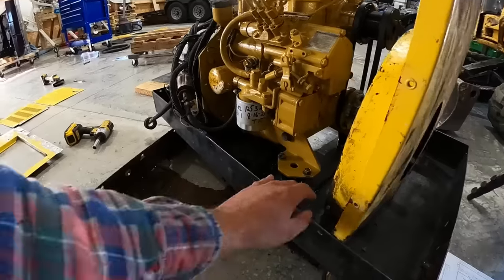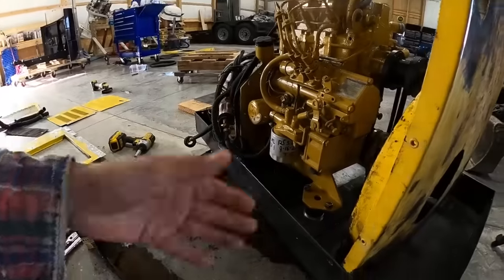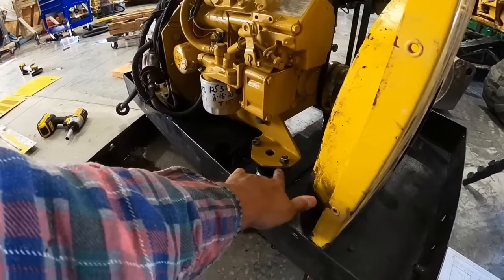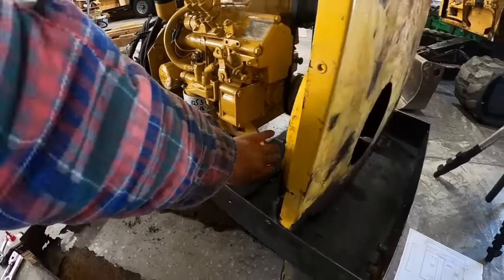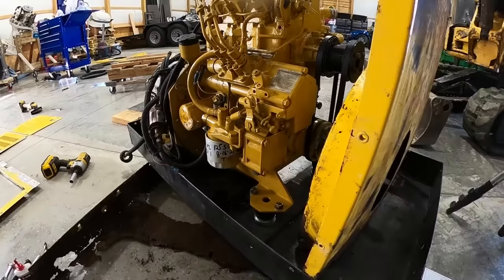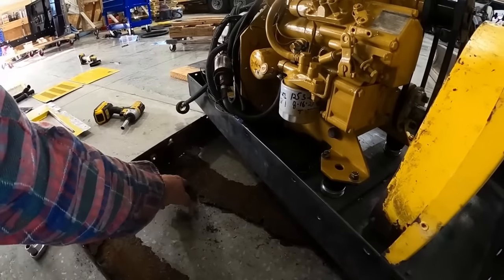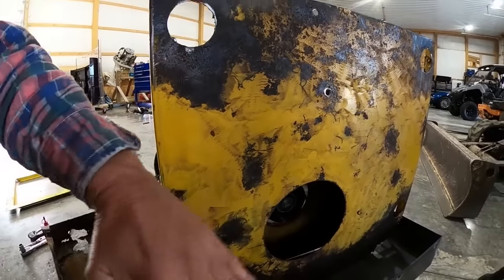I'm not sure what they figured out. I think these are the wrong size. I do have bigger ones on a quote request, but I haven't heard anything back, and I have the suspicion I'm not going to hear anything back. The companies that sell these, they want you to order like 1,000 at a time. Well, I don't need 1,000. I need 2. And I think that's probably what he ran into, and he ended up somehow finding these, which are just for the rears, and he put them on the front. And then I think he stacked rubber pieces up underneath there, but since the bottom plate was so worn out, I think the rubber just pushed through because it was sitting on this, and it was grinding on the bottom of this plate, and this plate was probably holding the motor up, which is terribly sad.